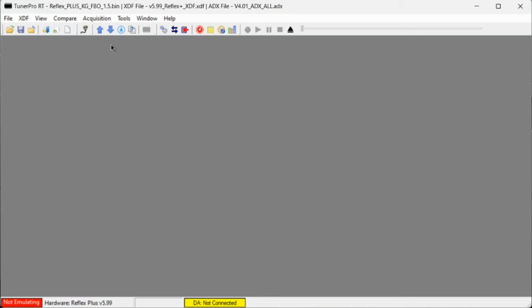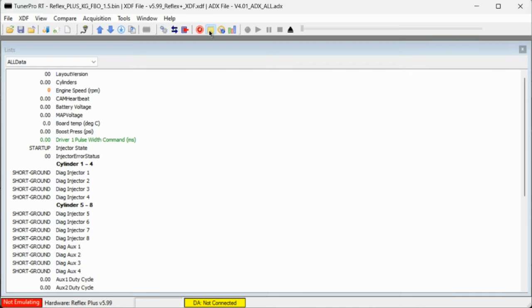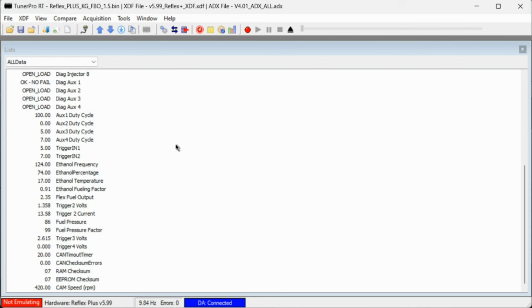Just go through your work again and again — sometimes you literally have to take it apart and inspect things to make sure you're doing it properly. A good way to make sure you're getting all the right signals is to idle the car while your laptop is connected to your Motive Reflex. If you go into the logging screen, you can see all of the data for your cam heartbeat, crank position, engine speed, and things like that. All of that should be active with numbers fluctuating. If anything is frozen or stuck at zero, it's potentially an issue — follow the wire from the installation diagram, make sure it's wired to the right wire, and make sure it's piercing the wire and getting a good connection.